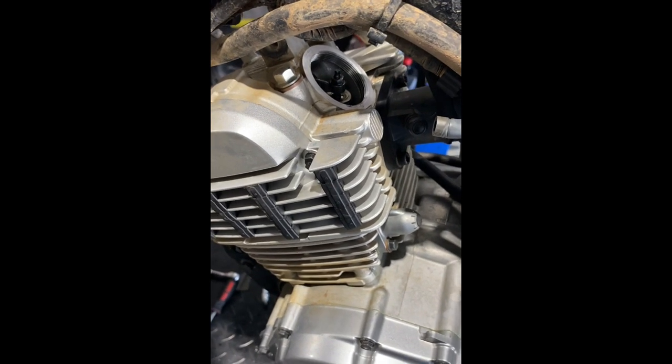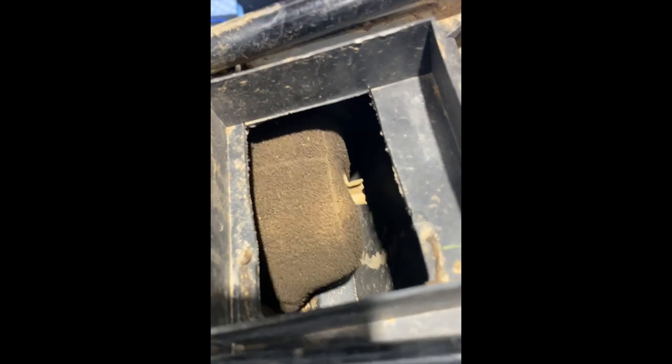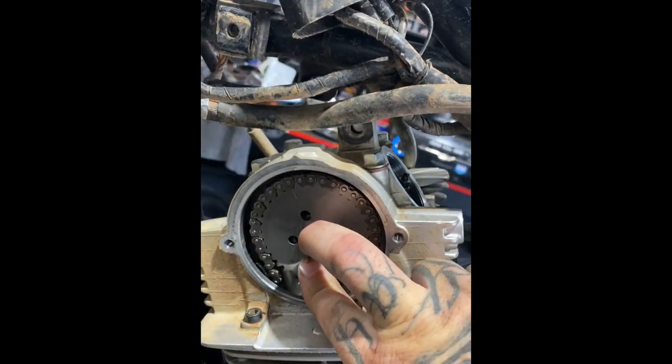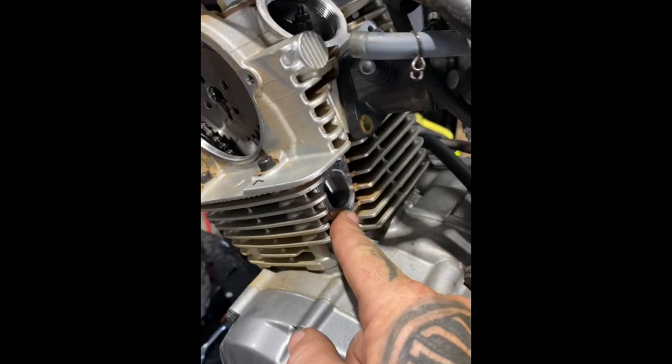The issue with the plug is it was running quite rich — and I wonder why — because the airspeed coming in is a bit knackered because someone doesn't clean their air cleaner. Next up, cam covers off. That was timed up at the top, but on rotation we're taking that out. Cam chain tension is out.